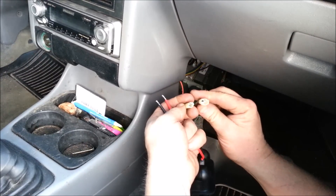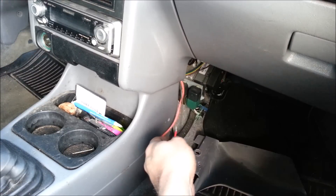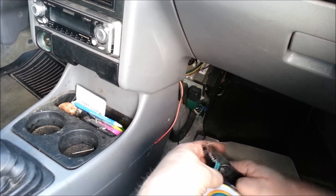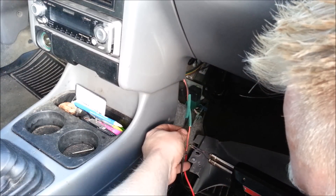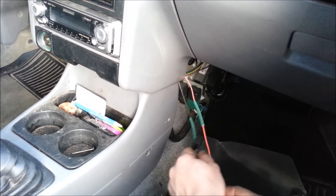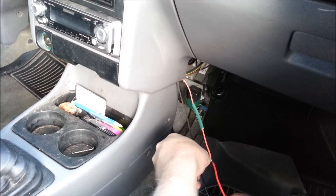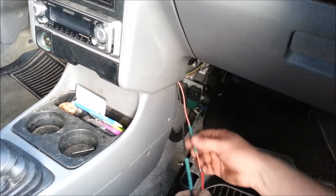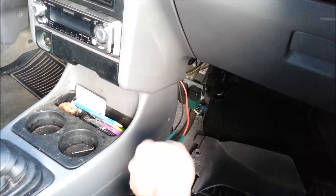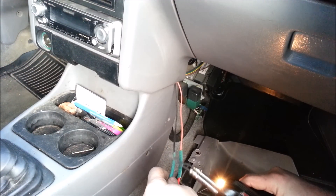You could just crimp on some shielded spade connectors — just a little male/female, but this has a shield around it so it can't touch anything. I'm just going to solder these on and add some heat shrink tubing around them so they'll never fail. Nice permanent bond, little heat shrink tubing around it. If this was outside, I would put some dielectric grease on this joint all the way around it to seal it. Then we'll just slide this over, bring it in the center, and use a lighter or the soldering iron's heat to actually heat shrink it.